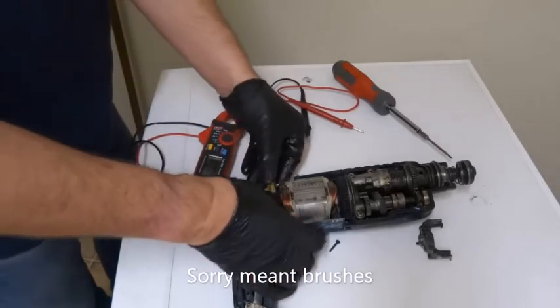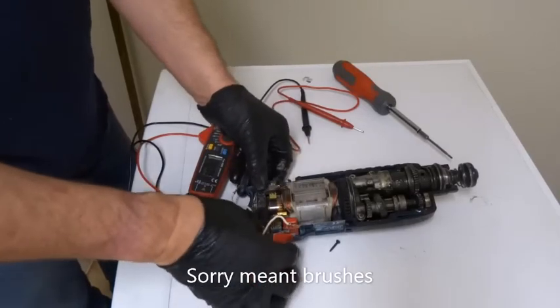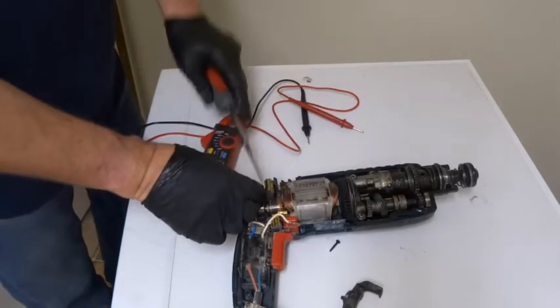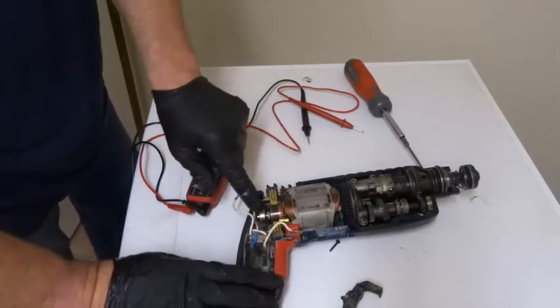To take these points out is a bit more difficult than most machines. It's got that little bearing cap. Push the brushes out — you can check the size as well. You may as well, when you're doing that, change that bearing as well.